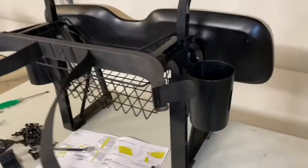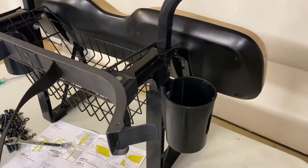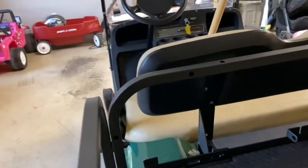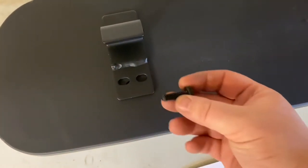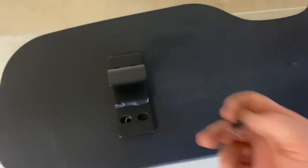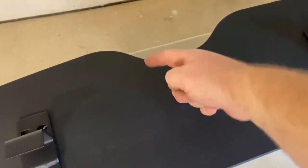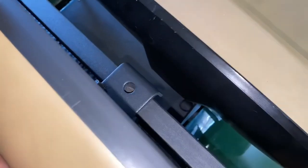I'm going to pull out the seat using that bolt and that bolt so I can reuse the original seat on the new assembly. I can leave the rest of the bracket assembly together in case I need to sell it. My hardware was a little too small — it went through the holes of the brackets, so I used some of their washers to make it fit better. Now it's sturdy. These are going to take smaller washers and lock washers. Pop it together, making sure the brackets are facing down, and there's an arch up here for the back row seat. The bolt goes through when lined up with the hole, then put the nut and washer on the other side.